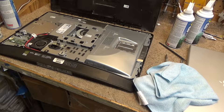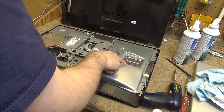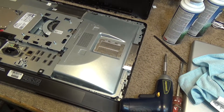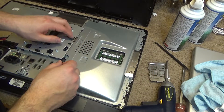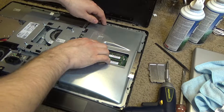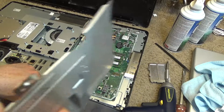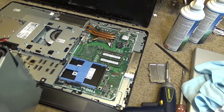I will give it to them that at least this was built to be fairly easily serviced. The RAM is under there. The drive is under this whole thing — I'll just go through how to do that for explanatory purposes. There's the memory, very easy to change, replace, upgrade. This presses down and slides out, and then you have access to your drive. It's a standard two and a half inch drive. Your CMOS battery is right there in plain sight. Wireless card too.